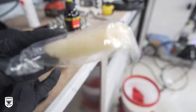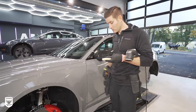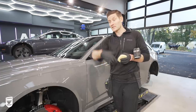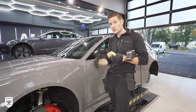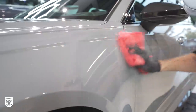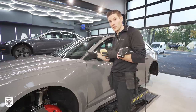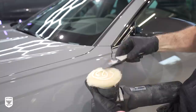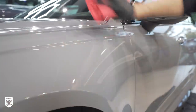What I'm going to use is the medium wool polishing pad on the three-inch Rupes along with the DA fine polishing compound. The reason I'm using this is kind of interesting. People think wool is a little bit stronger, but it's actually the opposite — this doesn't generate as much heat as microfiber. And why that's important is we have a brand new car here with fresh paint. There may be some expanding and contracting, and I don't really want to do that to brand new paint. So this particular type of wool pad is going to generate less heat than microfiber. It feels a bit crazy to polish a brand new car, but at this point its age is somewhat irrelevant — this paint is scratched and it's not perfect. The owner paid a lot of money to have a perfect car, and we're putting a clear bra on, so a correction must take place right now.